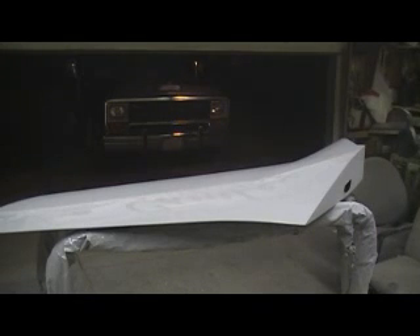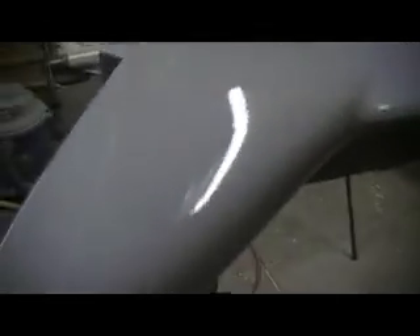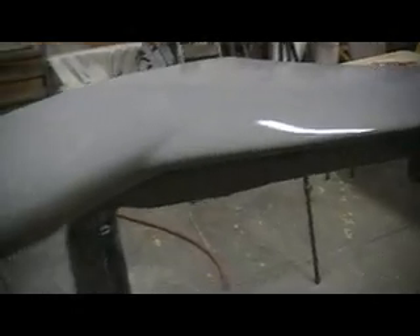There we go — got a nice breeze tonight blowing right out into this. Oh, that's looking good, look at that — that is smooth, smooth, smooth. That's slicker than a slug on a wet rock right there. Man, that thing is flat. That urethane primer will lay down even a little bit more, it will be flat, man. Tomorrow I'm going to hit it with 600 — I'm going to let it dry out tonight, let it cure, get a little hard. I found if you just sand it with 400 and then clean it with window cleaner before you go sticking the panel line tape on there, it'll stay on there a lot better.